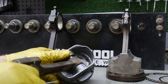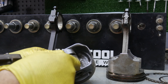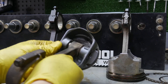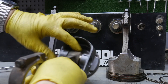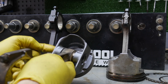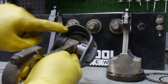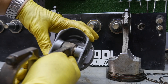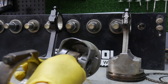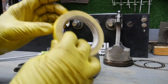Before we drill holes, let's look at the underside of the piston, because we don't want to compromise the integrity or strength. We don't want to drill anywhere around the wrist pin boss — that's all the meat connecting the rod to the piston and the piston top. We don't want to mess with that. So we don't want to drill where those indentions are. We want to do all our drilling away from that meat on the sides. I'm going to drill two holes, one on either side, and we've got an easy way to mark that before taking it to the drill press.